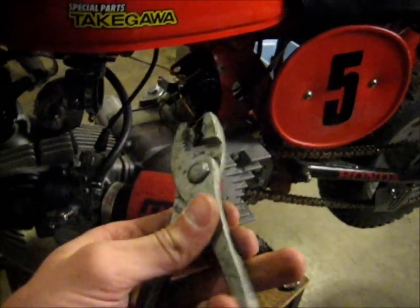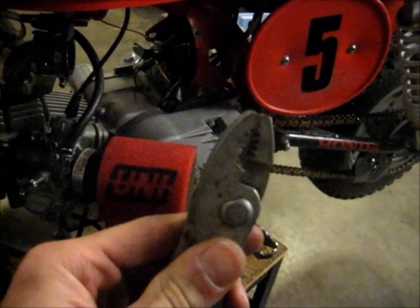Cool tool tech for you guys — if you're like me, you like new tools. Let me show you my master link pliers. It's a regular set of slip joint pliers, but you grind one of the sides down so it's a little bit shorter. Then on the shorter side you also grind a notch into it, and that fits over the pin of the chain master link. The pin goes right into that notch and then kablam — it lands on your shoe every single time. This is a great tool.